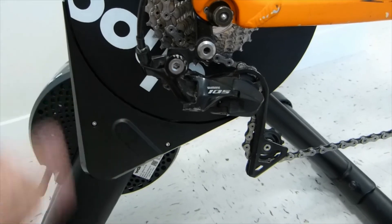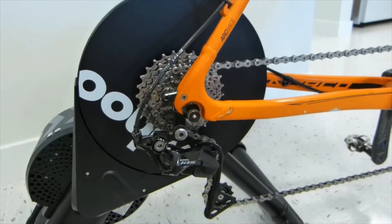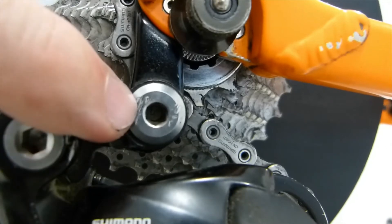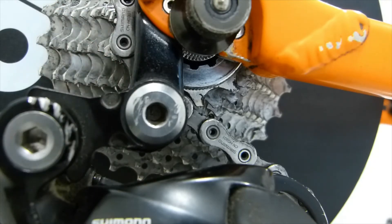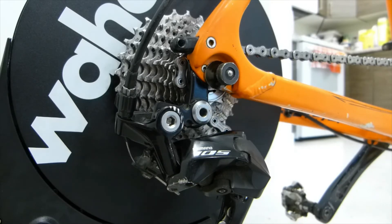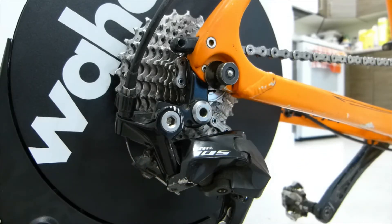That's necessary for the accurate shifting of the chain across the sprockets on the cassette set and the silent run of the chain. I also adjusted the cable tension and a limit screw here with this small Allen key or hex key, to ensure that the bicycle actually shifts through all of the gears in its entire range accurately. The limit screws may not adjust with the same tool on your particular make and model of derailleur. But it's a geometric necessity to have upper and lower limit screws somewhere on your derailleur, because the derailleur limit screws limit the motion of the derailleur sideways, so the chain is shifted onto the smallest sprocket but isn't thrown off into the space between the frame and the last smallest sprocket. The upper limit screw does the same at the other end — the derailleur should shift the chain onto the largest sprocket without throwing the chain off into the space behind it. So that's where the limit screw comes in, to limit the motion of the derailleur at that extreme.